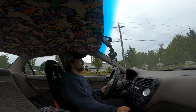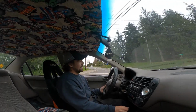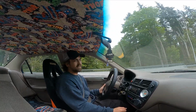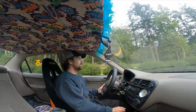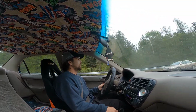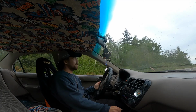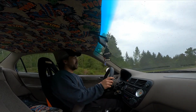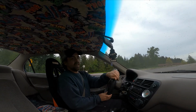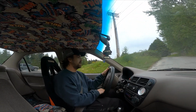Feels good. Hell yeah, I'm stoked. We need to figure out that little part in the tune, but that ain't nothing but a thing. It's something simple, I'm sure. Yeah, it feels like... It feels weird, honestly. It feels good, but it feels like it's way too rich. So we're just gonna have to check out a couple of things and make sure everything's okay. Make sure we don't have any vacuum leaks, that's another thing. Make sure the gate's hooked up properly.